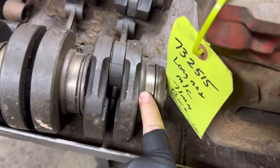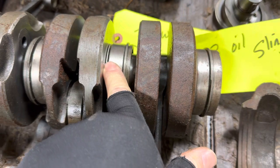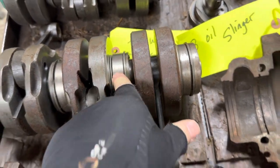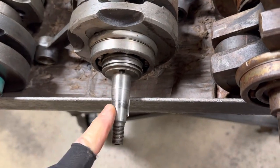Your slingers are right here on the crank. If you've got a crank and you're missing this part here, it's injected — and if you're missing this part, that tells you it's an early Monte Carlo or GT crank. That's another way to quickly tell your stuff apart.